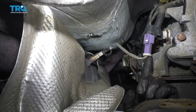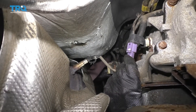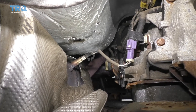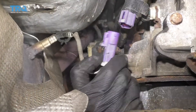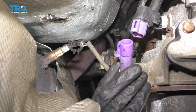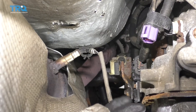One of the first things I like to do is disconnect the wiring. You can take a small pocket screwdriver or even just your finger, push on this tab, and then separate the two pieces. I always like to take a peek at my connectors on both sides just to make sure I don't see any funny colors. I know I'm replacing the O2 sensor, but if I see some corrosion on this side, more than likely there's some on the other side.